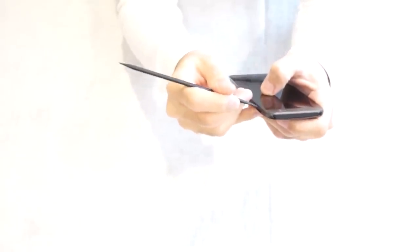damage the phone. You're going to work your way around the edges where the power button and the volume buttons are, and you're going to push in and lift up. It has clamps all around. We're going to remove the top. It separates from the middle part of the housing. So let's work our way.